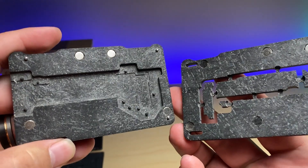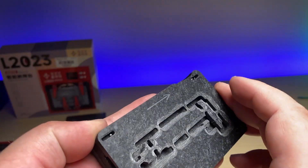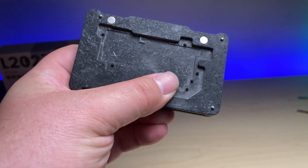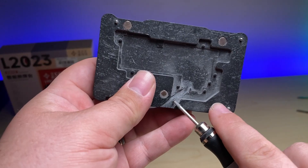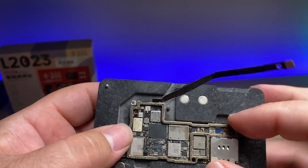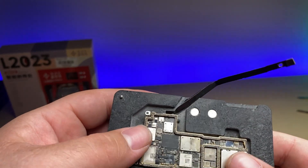As you can see, it comes with the ability to install the 13 series inside and clamp down on both sides. I've ground out an area that will allow for the 5G antenna to not have to be removed during this process of reballing it.